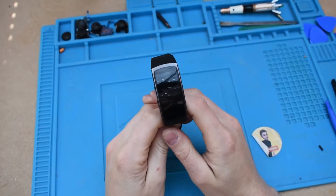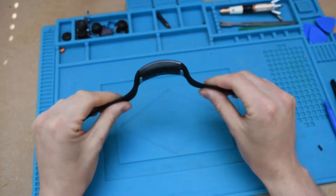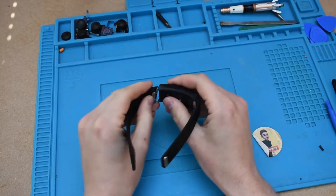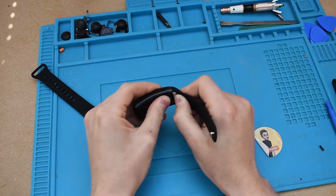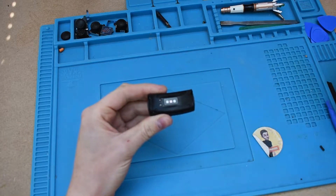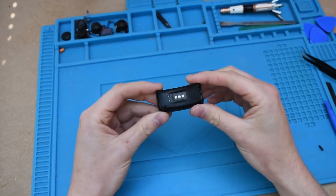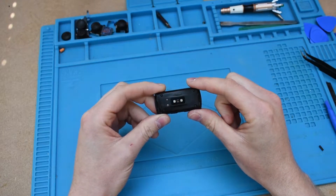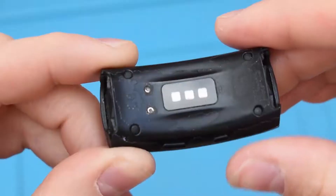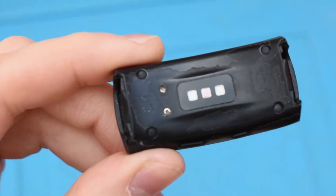The Galaxy Fit 2 is not working at all. I've tried charging it and turning it on — absolutely nothing. So first we'll get these straps off; they just push in and pull out. I can already see there's some corrosion on the contacts. I've tried cleaning them up but they're pitted, so I don't think it's making a connection when it goes into the charging cradle. I'll quickly zoom in to show you — these contacts are a bit worse for wear, a bit pitted, meaning they're worn out slightly in the middle.